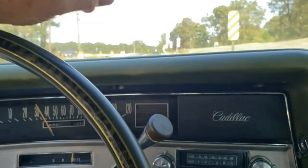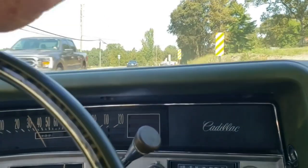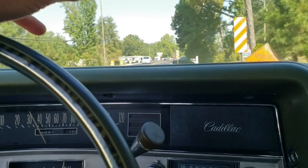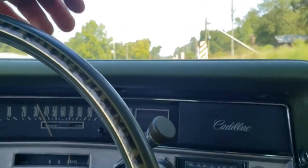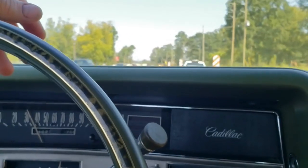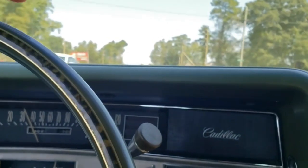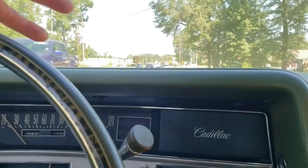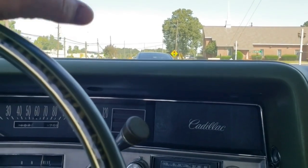I have tried both ported and full manifold vacuum timing advance for the engine, on a variety of initial base timing settings, anywhere from the stock 8 up through about 14 to 16. I've tried 8, 10, 12, 14 on both ported and full manifold vacuum. The phasing issue that some have described, I'm not sure if that was happening or not. It sounded like the miss, the stumble, the rough idle was more aggressive on full manifold vacuum. There could have been some effect of that phasing that these engines are apparently susceptible to.